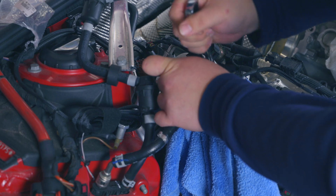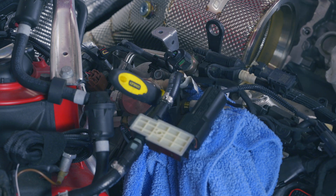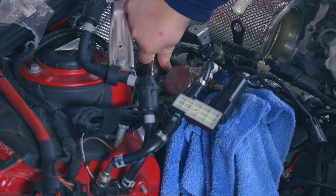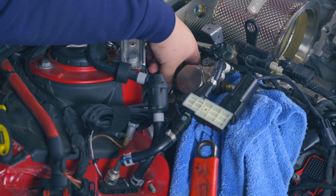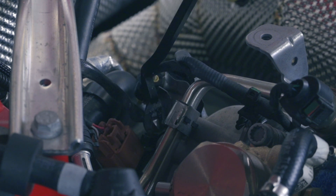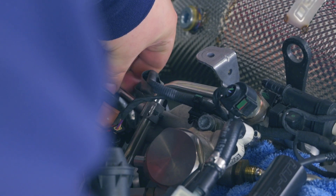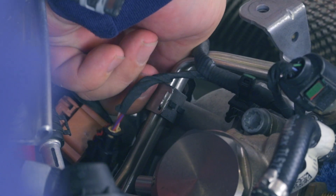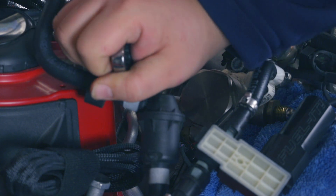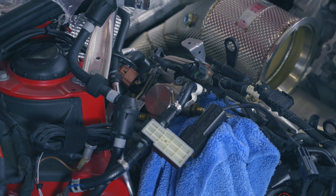17 over here — break it free. It is not a whole lot of torque. There may be fuel here. My car's been sitting for a few days, so I probably don't have a whole lot of fuel. Yeah, there's not much coming out. In the back, we need a 27-mil wrench, and I just don't have those giant wrenches — it's something I've overlooked. I use a trim removal tool to get to the back here and pop off the little harness. There's a little T30 on the hard lines back here. Now we're going to use a 14-mil to break loose this hard line. It's pretty light, a little fuel in there. Now we're going to use our M10 triple square to bust out the housing.